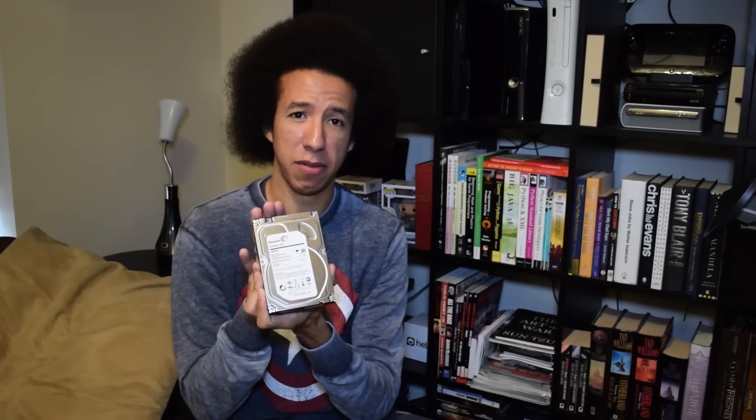In the PS4, that takes a smaller laptop hard drive. I've bought one of these because it's a lot cheaper — laptop-sized hard drives are quite expensive, especially for something of this capacity. Officially, the PS4 supports up to 2TB, but it can support up to 4TB if you disable rest mode. Rest mode is not something I use all the time anyway, so I'm fine. I want to future-proof my PS4. If you think about how quickly it took you to fill 500GB or 1TB, think about how quickly it will take to fill 2TB. That is why I've gone with 4TB.